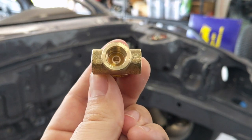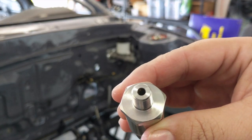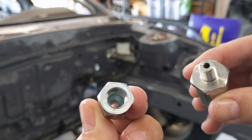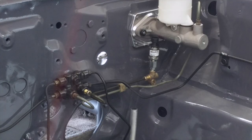The sensor is 1/8 inch NPT, so I have to use an adapter that goes from 1/8 inch NPT to M10 by 1.0 flare. There you can get a look at what the T and the sensor look like installed. I used a little plastic OEM bracket between the two brake lines to keep them in line, and I'll use that hole on the T to bolt it to the firewall so it's solid, with a spacer to hold it about an inch away. Then I just need to make up the line that goes from the other side of the T to the master.